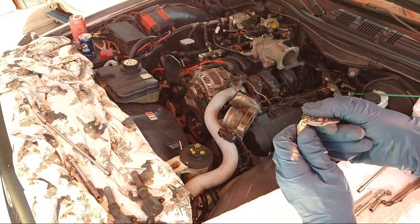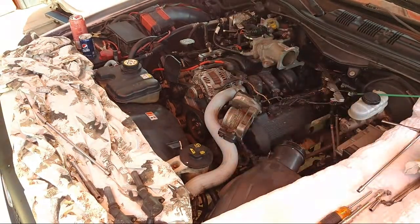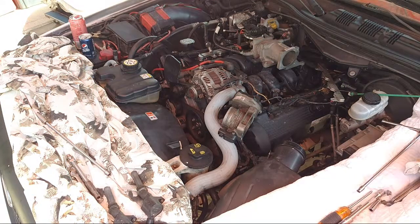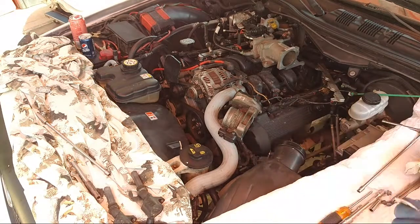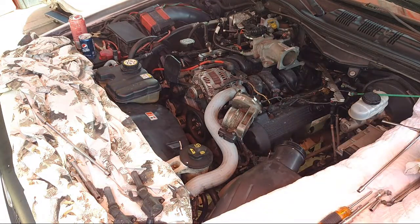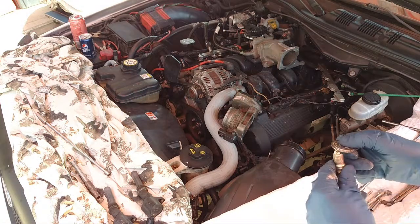And you kind of don't want this arm to be more than a right angle. You don't want it to open up more like that, so you visually can look. And so it looks like 040 would be the proper gap for this. I was just kind of going by the other plugs that I did before, but that would be too much though. Let's see here. Yeah, so all these plugs came 040 except for one, and that was 050, so that's probably wrong.